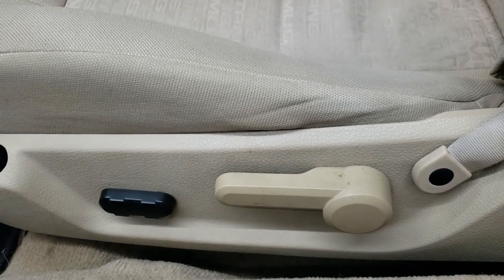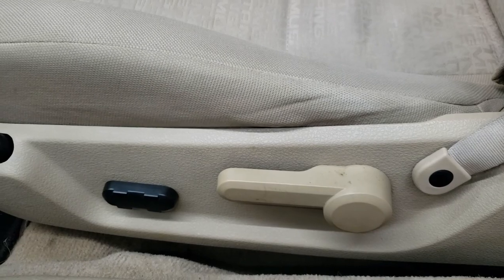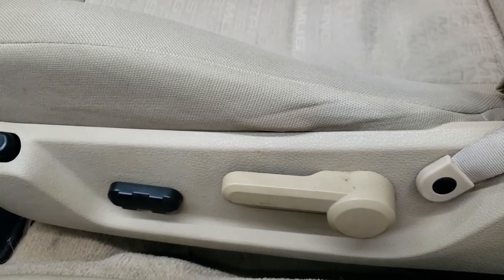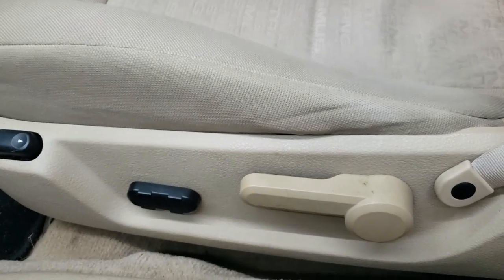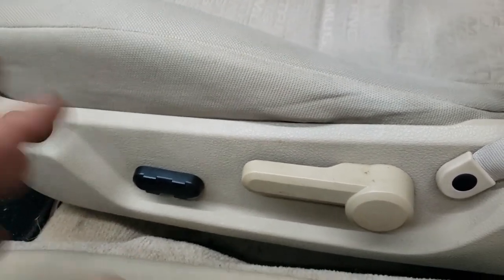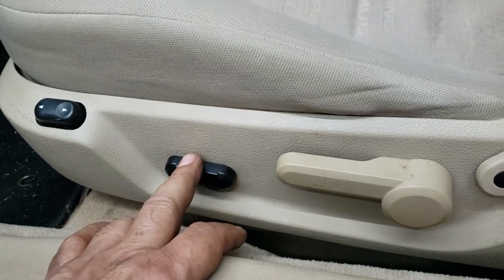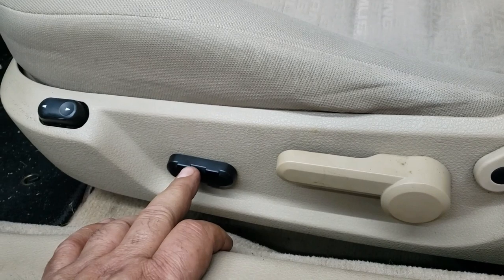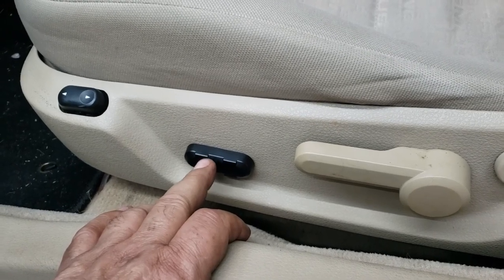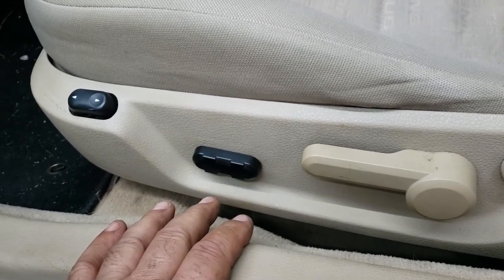Remember, this is an '07 car — the seats didn't move as smoothly as newer cars. This car only had power seats on the driver's side; it was the premium package V6. A lot of V6 Mustangs without the premium package had manual tracks. If you want to get rid of the power setup, you could always go to a salvage yard and find a manual track. This is a pretty simple fix. The switch itself is about $140, but if you go on eBay and cross-reference the part number — this switch was used in a lot of other Fords — you can get it down to about $56. I'll put an eBay link in the description so you can see the cross reference.